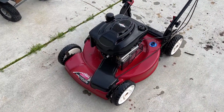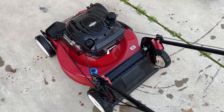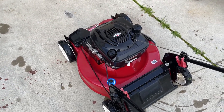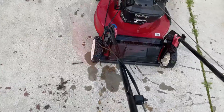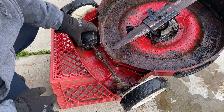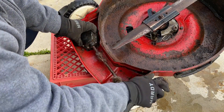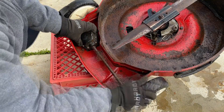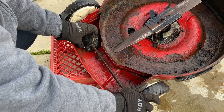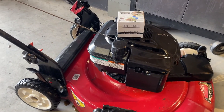I just gave it a bath and noticed another problem. Instead of removing the spring I just took all the slack off the belt and rocked it back and forth, and it looks like I was able to free it up. So we don't have to scrap out the whole assembly — they could still have self-propel. The belt still looks like it's in decent shape.